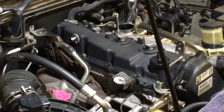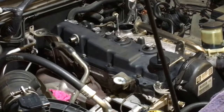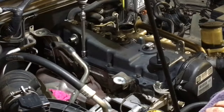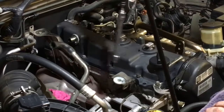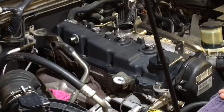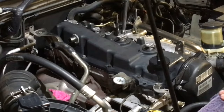Okay. We couldn't see any cracks in this cover. I know there was some bit of oil staining around and whatever. I'm not too sure what was going on there. There's nothing we saw. Maybe the valve cover gasket was leaking a little bit, which is unusual, but this one is 14 years old. So just gonna give these a quick zip down. Now, I'm not going hard. We're just taking up the slack, right? Same even here at the front, right? Just taking up the slack. New gasket's very soft.